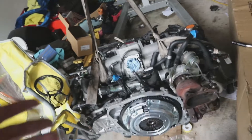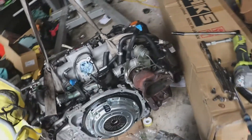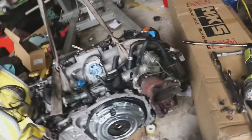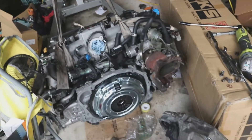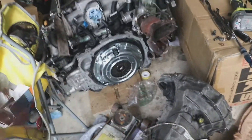This will also let us find out how many hoses were cut and which ones need to be refreshed or replaced because of age. I also lightly pulled the turbo up and out — I had to remove some of the oil access lines to make it easier for things to move around, because with the oil lines in place that side of the turbo sticks into where the bell housing would go. Now we can actually line up the transmission perfectly and send it in place.